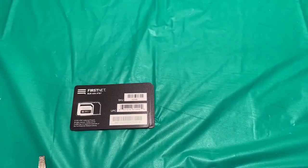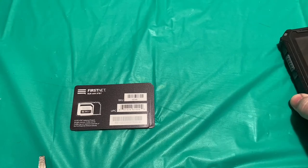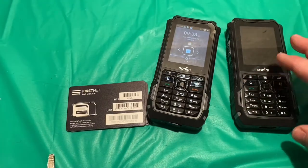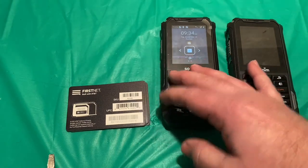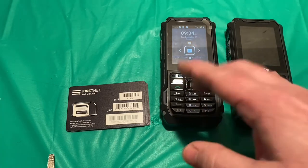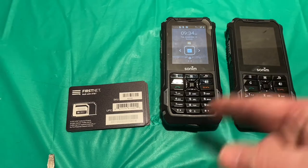Today we're trying out a new fix for the issues we've been having lately. Anecdotally, I had two phones where one was running really slow with the EPTT and one was running just normal. They both had identical firmware, build number, and AT&T EPTT application version numbers, but one was fast and one was slow. We swapped SIM cards and the behavior followed the SIM card.